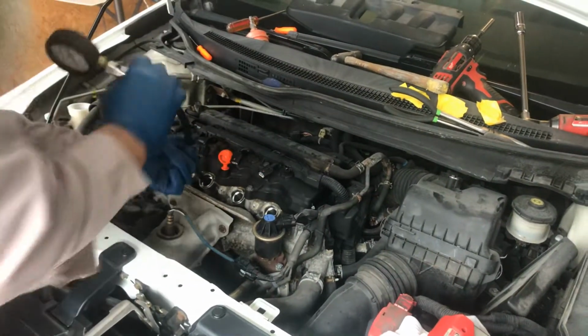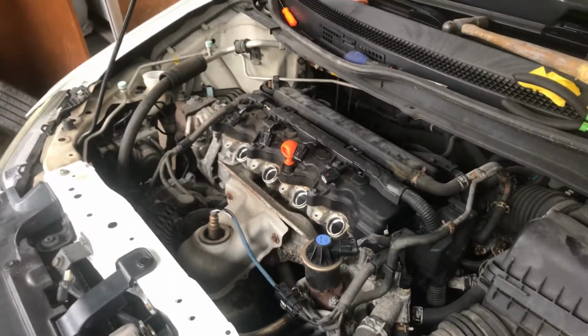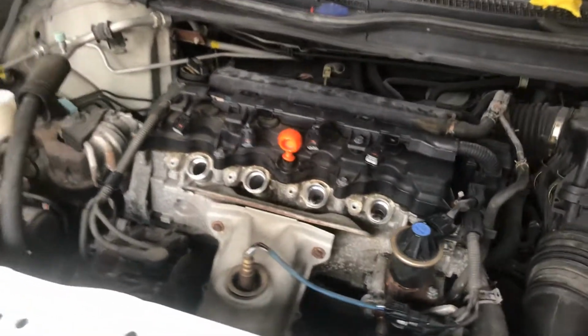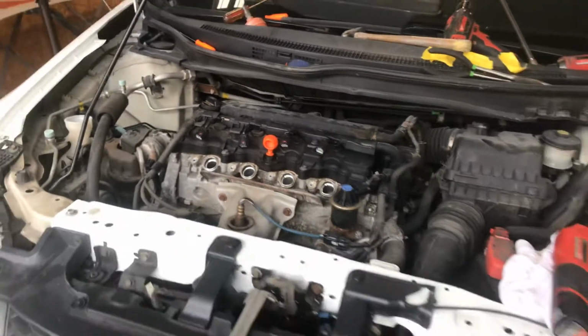Yep. You take the head off and get a new head gasket and have the head resurfaced, if the chain didn't jump and bend the valves. Right. And really, all you need to do is resurface the head. Right. I think I'd probably do that. You think so? Remove the head and then take a look at the cylinders right there, if they made a mark or not. Unless you want to go to the engine, right?